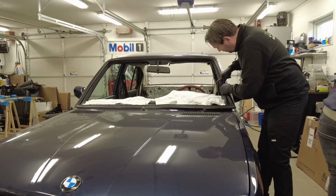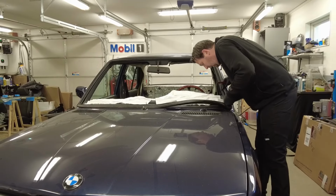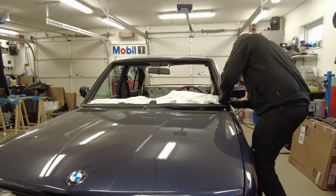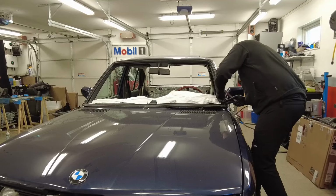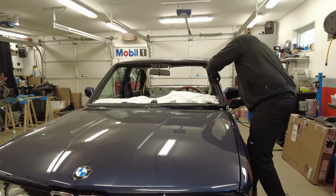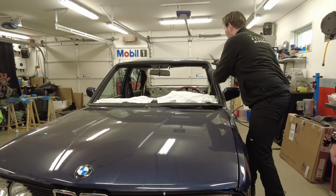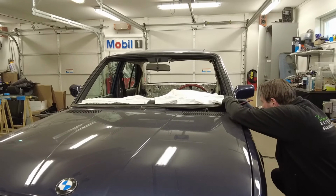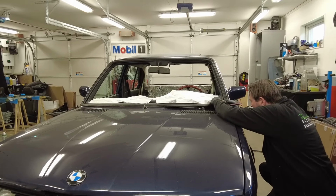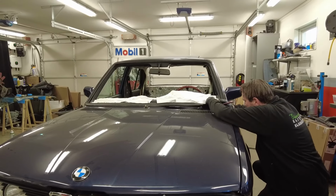So it's really nice to work with still, but yeah, it is tight. And it's important to get it in place all the way in, so you give maximum room for the window later on, because if this one is not fully in contact with the steel frame, there will be not enough room for the glass to fit inside.